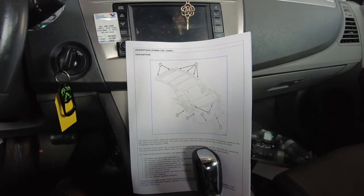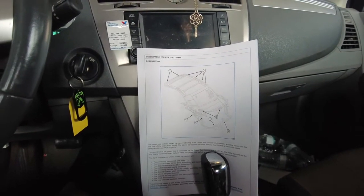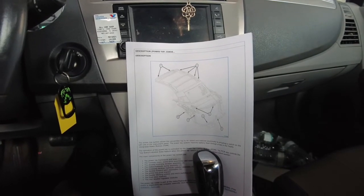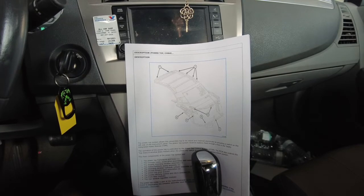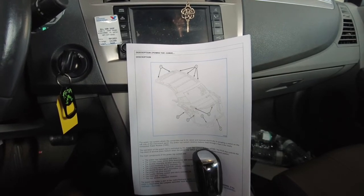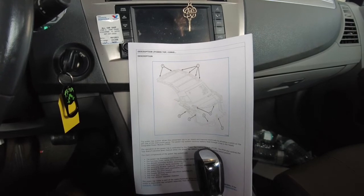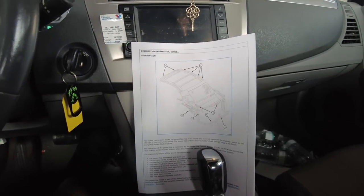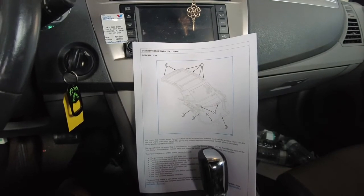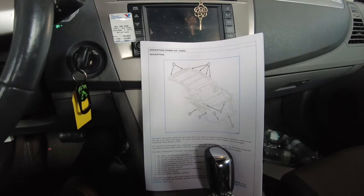It's not that scary — it just takes a little patience and a little digging, pulling panels off and checking wiring. You can actually change the switch state by grounding those switches. All they are is grounds, so you can ground them yourself and see if it changes on your scan tool. If it changes state, then you know the wiring is good and the switch is probably the problem. If it doesn't change state, then you've got to find a break in the wire.